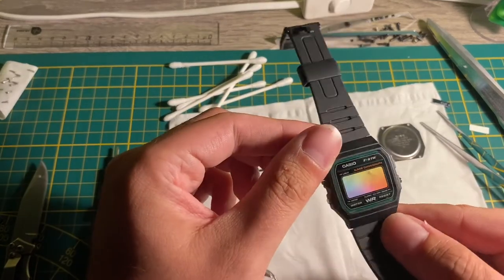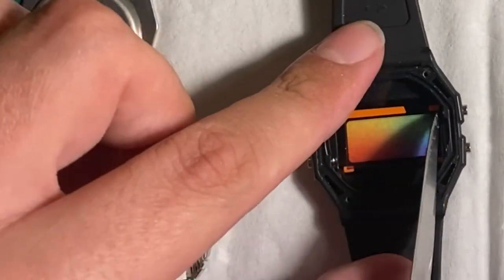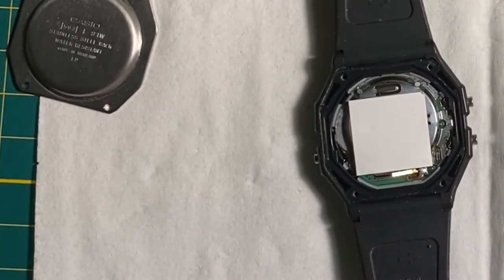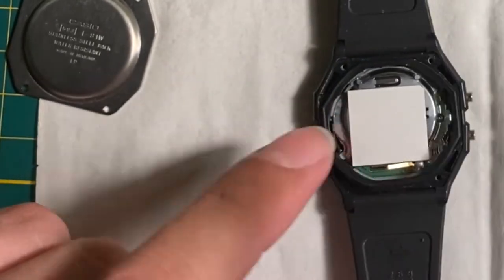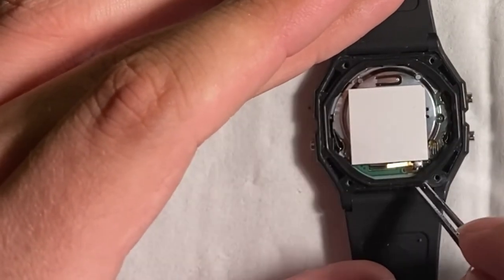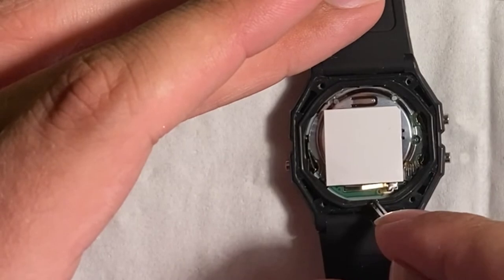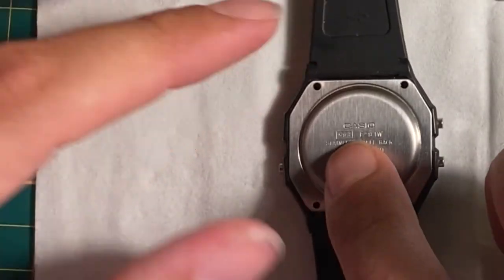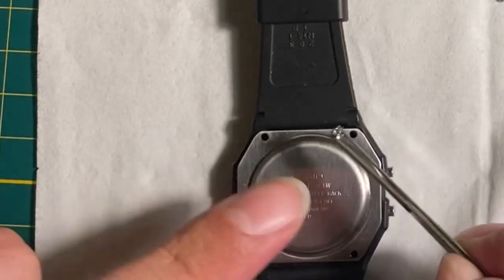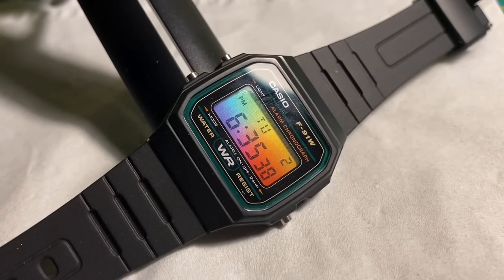Now I'm just going to turn it around, take a look, and make sure there's no air bubbles or any excess adhesive showing. Then I can just reassemble it — make sure that all the buttons are pushed out when you're reassembling, so the movement should pop right back into place. Take a minute to make sure your rubber sealing ring is sitting right in the groove. You'll know you did this part right when you put the case back over top and it sits flush. If it's raised in some parts, your rubber ring probably isn't sitting right. Now I can just screw back in my four screws and I'm done. That's all there is to it, so thank you for watching and enjoy.